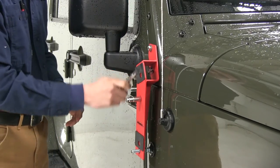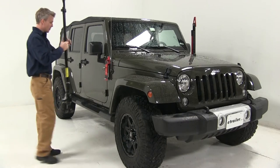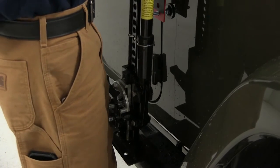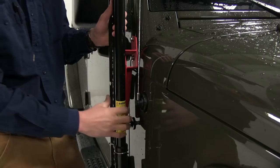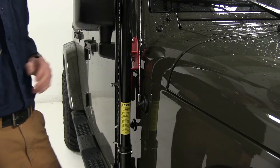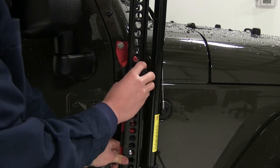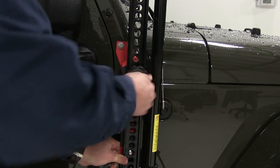Once we get that most of the way, I'll go ahead and start the other one. In positioning the jack, you just want to be sure and set it so that the foot does not come in contact with the running boards. The bolt is going to come through our holes, which is nice because it's going to kind of hold it in place while we put on our black knobs. Once we have it in position, we can take our knobs and screw it in place. You may need to rotate the jack a little bit just to line up the holes.